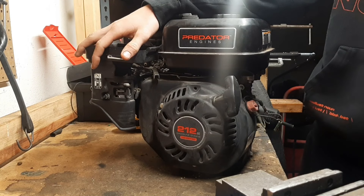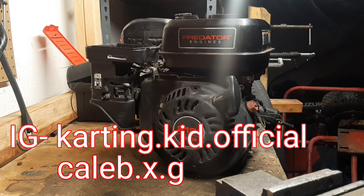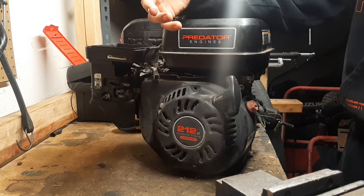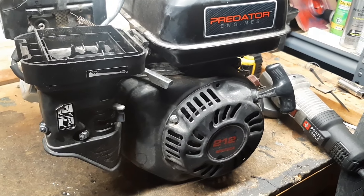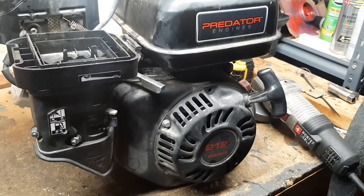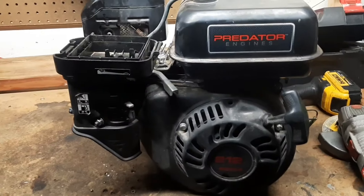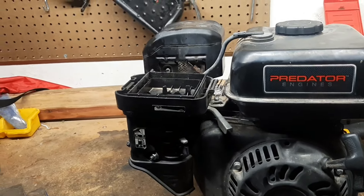Having a governor on one of these motors is like running a dog with a leash. You're in some control but not complete. When it sees a squirrel, or in our case 3,600 RPM, you're completely out of control. Basically all a governor does is limit or increase the amount of RPM the engine has to keep it running smoothly. The governor also acts as a rev limiter, decreasing throttle once it reaches 3,600 RPM.